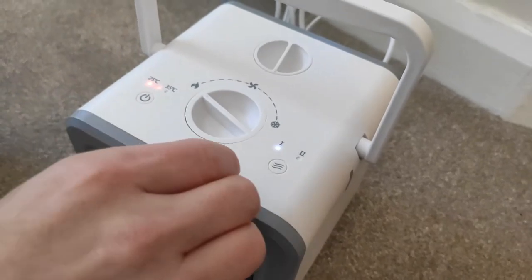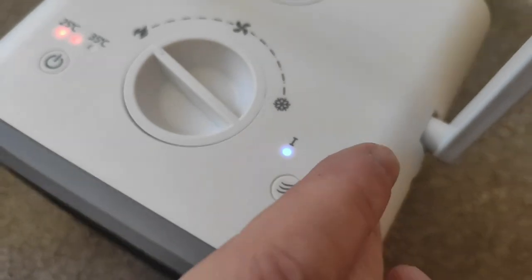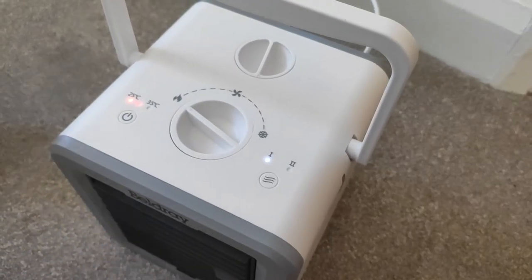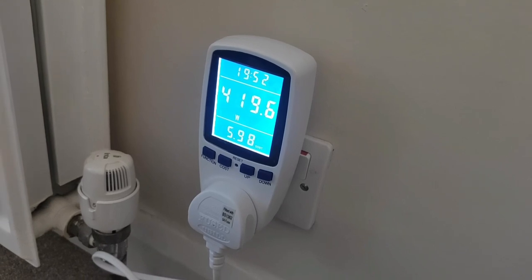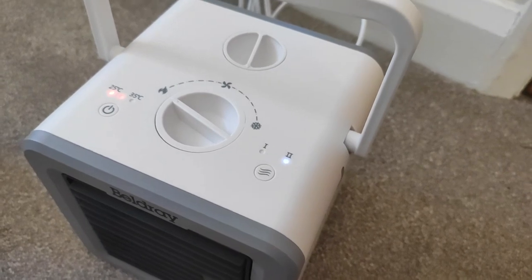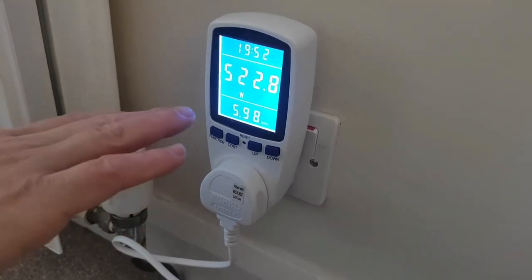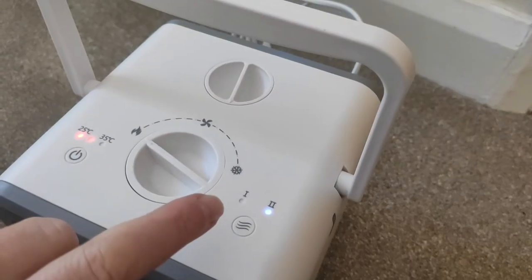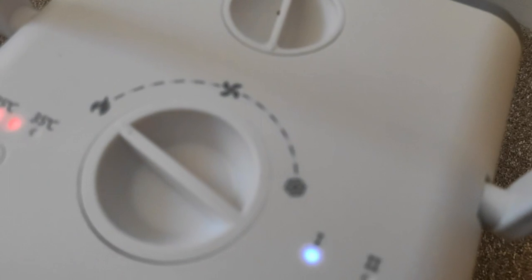Looking at the Bel Dray Cube again — on setting 2, the higher setting, it's using about 500 watts an hour, but it doesn't use 500 watts constant. It'll cycle on and off during that time, so it won't be 500 straight. If you knock it down to setting 1, there's only a reduction of around 80 watts, so it's not a great difference between 1 and 2. I expected setting 1 to be around 200–300 watts, but that might not be enough to generate the heat.